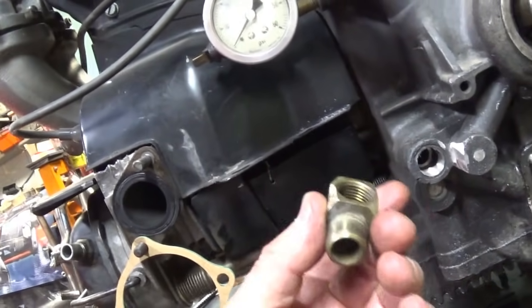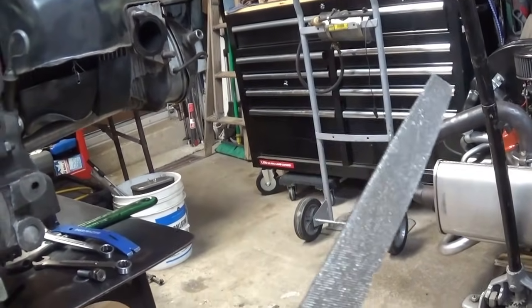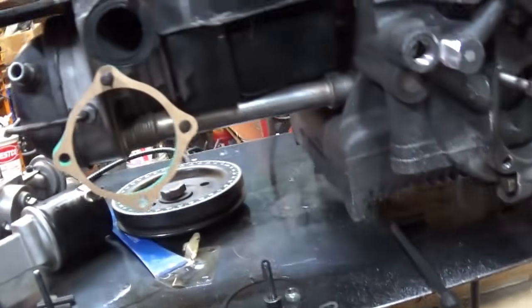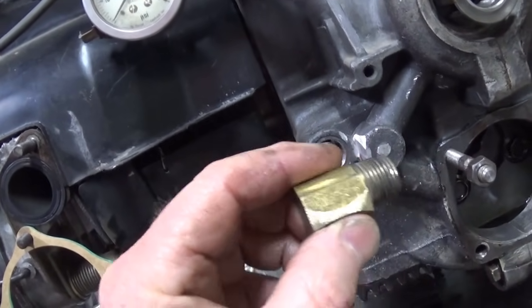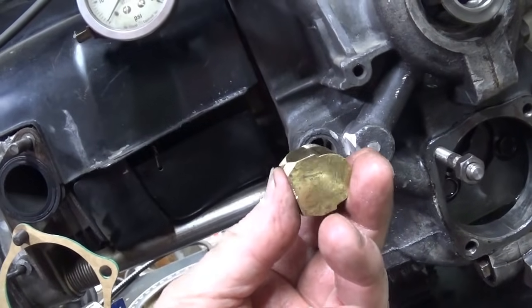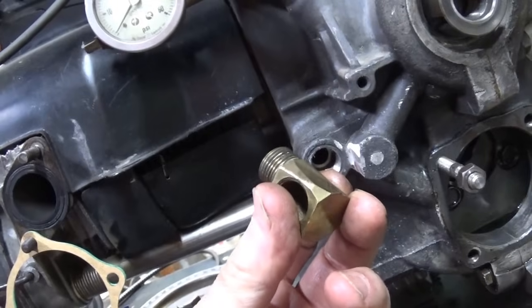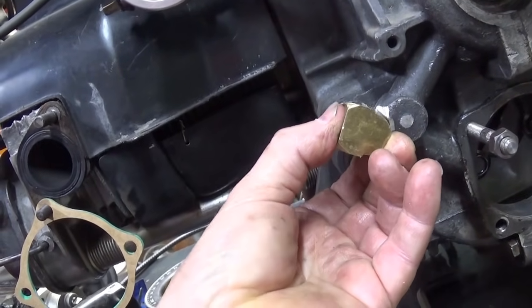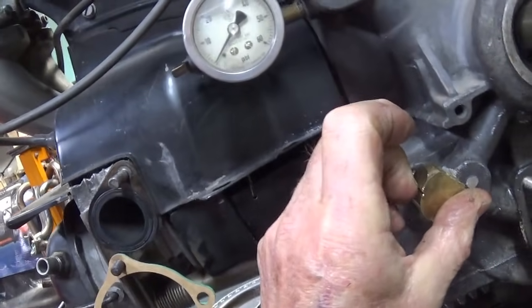People talk about full flow systems and you can do it on an assembled engine. These are what they call non-ferrous metals and what you want to use is a file - you could even use a wood rasp. A bastard file won't clog up like a mill file with finer teeth, which you'd always be cleaning. Don't try to grind this down on your bench grinder because it'll just plug up the stones.